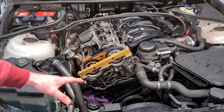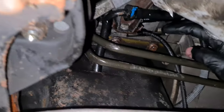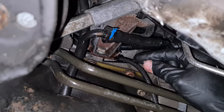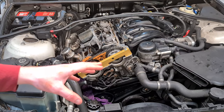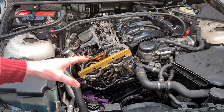I already have the locking pin inserted through the flywheel, so I'm going to put a link up in the card or down in the description where you can check out how to insert that pin. It's quite tricky. It usually takes about 10 or 15 minutes to get it in. But yeah, anyway, check that video if you need to know how to do that. So the engine is now at top dead center position.